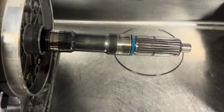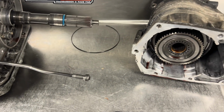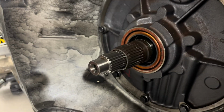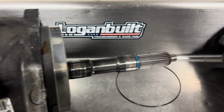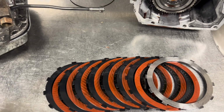So far, I am seeing that we have a Sonnax intermediate shaft in here, so that's some good signs there. But it's looking like it's going to be a stock output, so it's kind of weird for an 800 horsepower build that they would put a Sonnax billet input in it. I'm pretty sure, I'll confirm when I get that out. But Sonnax intermediate and then a stock output. But I've heard of guys doing that. It's kind of like an older school mindset with it.